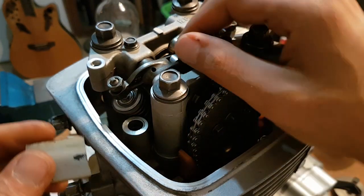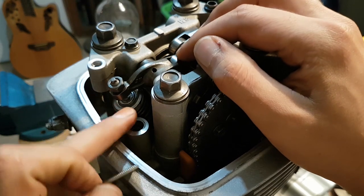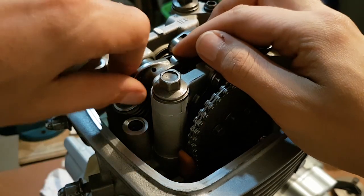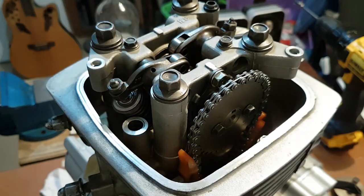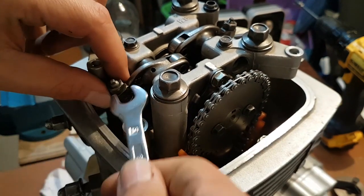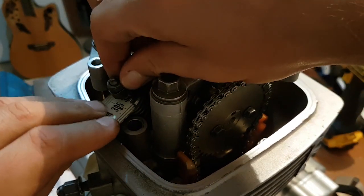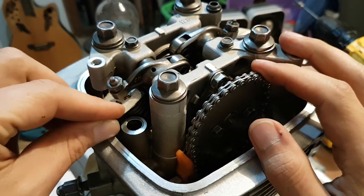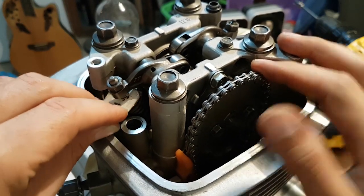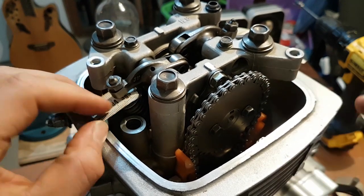As I said, we put the engine to top dead center and then we place this feeler gauge between the rocker arm and the end of the valve. I intentionally messed up my adjustment to show you how you can correct it — let's put the screw a bit tight. You check your valve clearance and in my case the gap is way too much, because the feeler gauge should have a slight drag when you place it in between the rocker arm, but this gap is exaggerated.